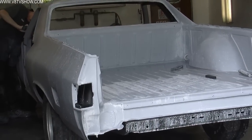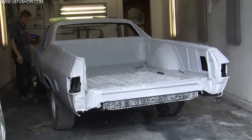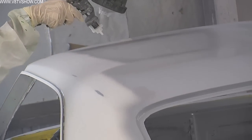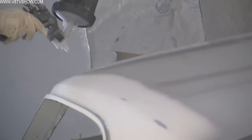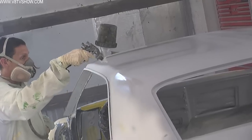Remember, body filler will absorb moisture unless it's something like the Quantum One, so it needs to be top coated with a primer. Here's where some people get into trouble. Primers are made up of multiple components — just for round numbers, you might find a mix ratio on primer of 4:1:1, which means if you have one gallon of primer you might have a quart of reducer and a quart of activator. So when it's all said and done, one gallon of primer becomes a gallon and a half of sprayable material. However, once you spray it on the car, a lot of that stuff evaporates off.